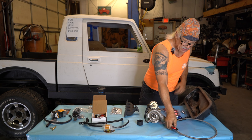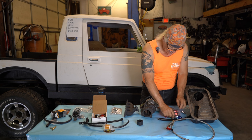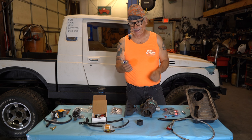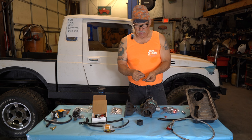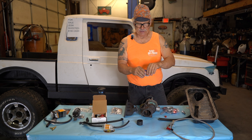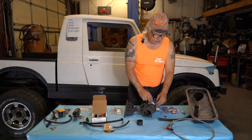Your oil drain starts at the bottom of the turbo when it's clocked correctly. You can see it has two threaded holes. We have a gasket and then we make a special fitting — this is from a T-4. There is no T-3 drain, so we make it. You take your two allens and two lock washers, put that on the gasket, make sure it's nice and tight. Use Teflon tape — this is an AN-10 fitting, and that is your drain.